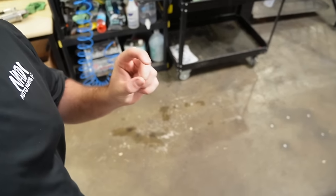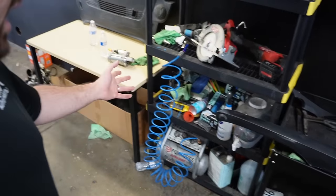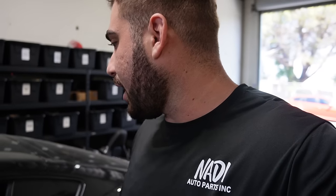One issue I'm having with this car is the cooling system will not bleed. It's a really weird system to bleed — we bought the tool but it needs a really big air compressor and ours is just a five-gallon, super tiny. The car keeps overheating as soon as you pull out of the shop and it just will not hold coolant.